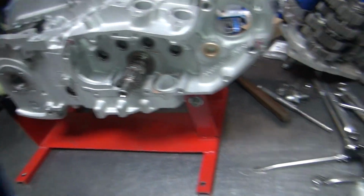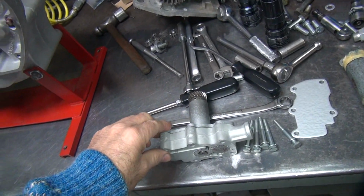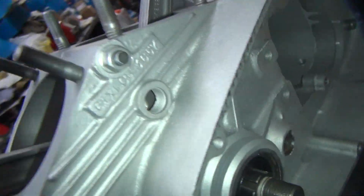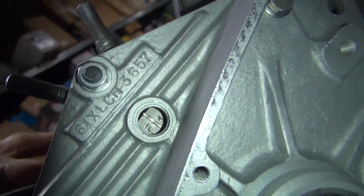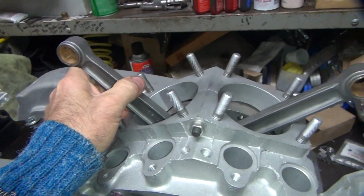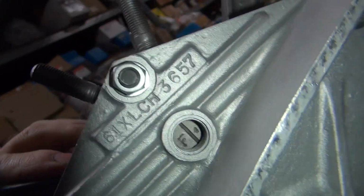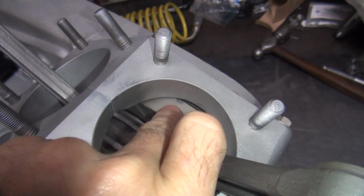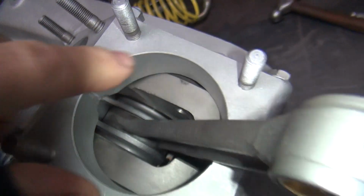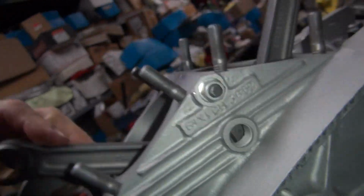Yeah, fun. I don't know. So, I gotta check the breather timing. That's what I was gonna go look at. So basically, you gotta put this thing on a timing mark, which is right there. You gotta kind of hold that about in that spot too. So one quick way of identifying it is to hold it and look at some mark that looks familiar. Okay, so that little thing right there lines up right with this mark here. Goes right there even. And that means our timing mark over here is where it belongs.